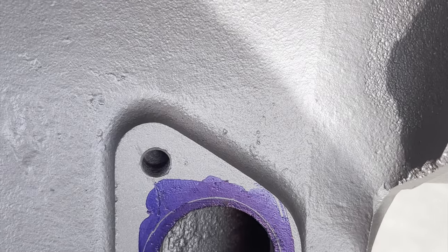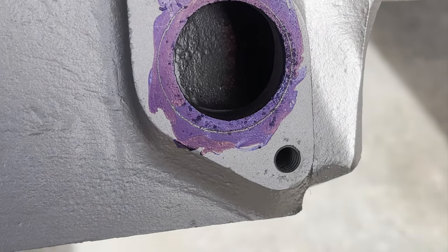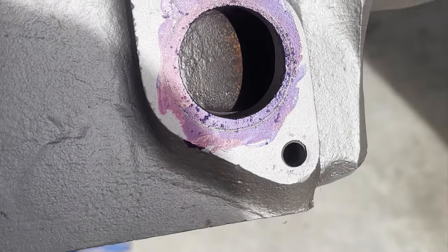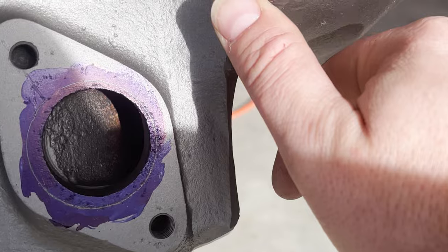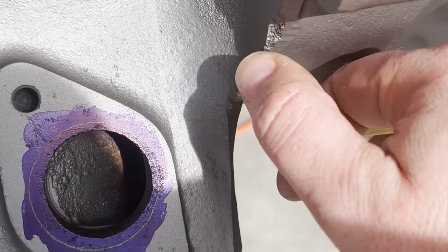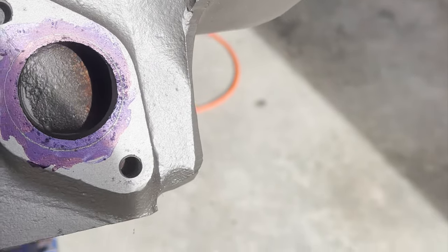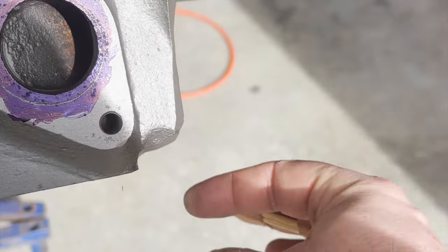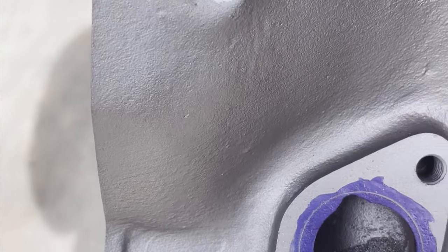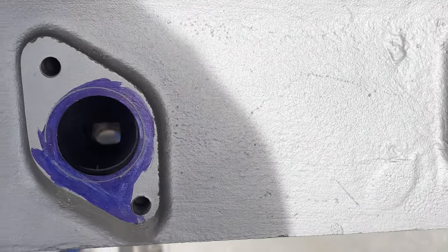And the reference I saw said we're opening up about 30%. So that's a lot more exhaust gas that's coming in. So this thing's going to breathe a lot better. This will be the last step for porting. And then we're going to go into cleaning up some of this ugliness. This is just from the foundry, big hunks of metal, so we can round this off and make this a little bit prettier. And there's a bunch of spots around that we can take these sharp points off and just make it a nicer block. So I'll be back when I'm done with that porting and I'll show you each one.